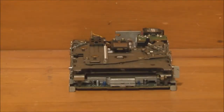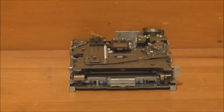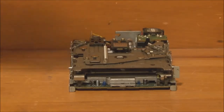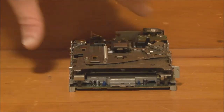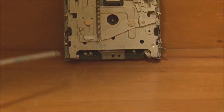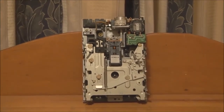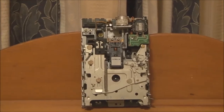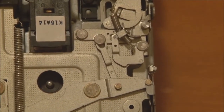There was a later version of this drive known as manual-inject, which was used on Macs from about 1993 or so onwards. Those drives required you — a bit like the drives you find on DOS machines — to insert the disk all the way in before it would actually drop down and latch into the mechanism. I would say they switched over because the manual-inject drives were a lot simpler and cheaper to make, since the loading mechanism of this auto-inject drive is actually quite complicated. What we have here is the loading mechanism over here — all these levers and rods are there to automatically pull the disk in.